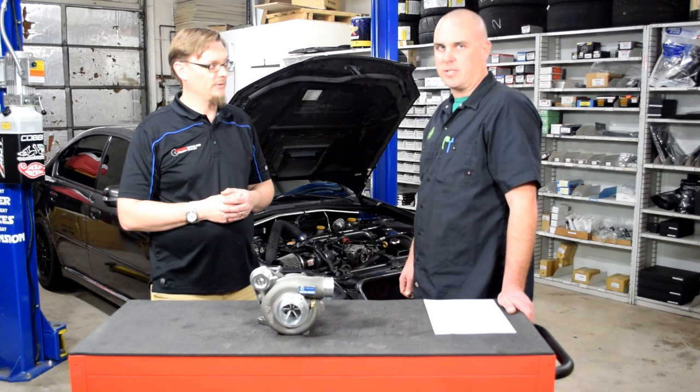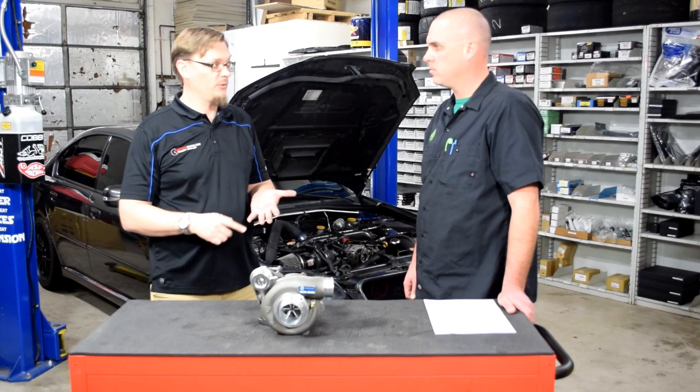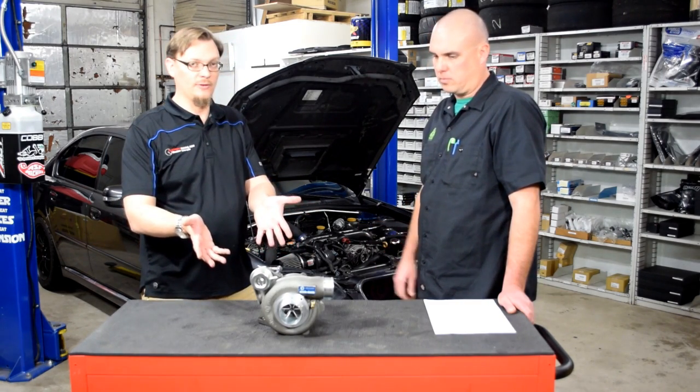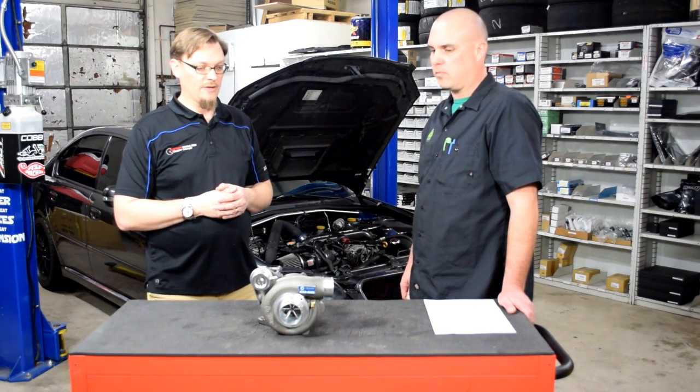Just the legacy and the scoop on the legacy — it's a limiting factor for us. The advantage of going with the front mount here is you get better cooling, and that's what makes it possible to use call it an STI-style turbo on a Legacy. That's what opens up the door to this family of turbos.